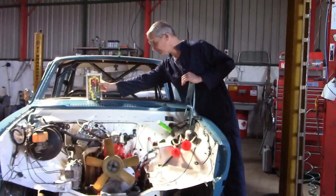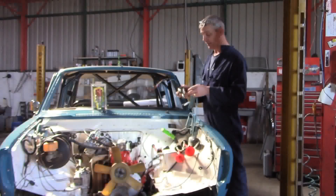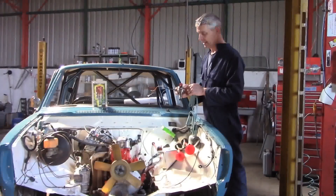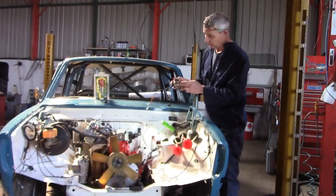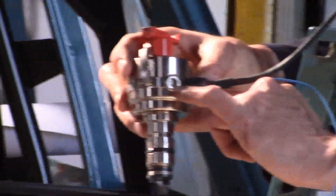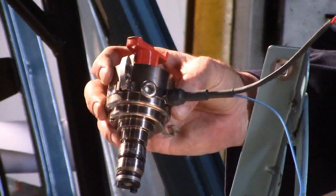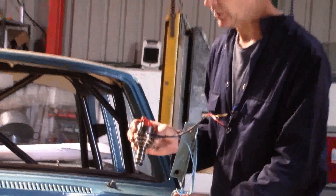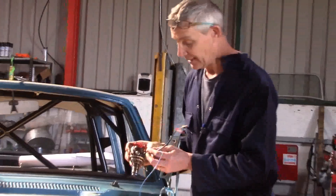Today I'm fitting our preferred motorsport option, which is the B18 B20 Tune — that's the part number. With the Tune, you connect via the USB port to your computer and program in your own curve. I'll supply you with our best-guess first-pass curve to get you going, and then you can tune it accurately for exactly your engine.